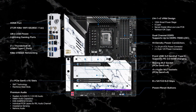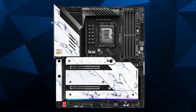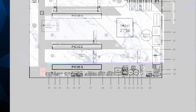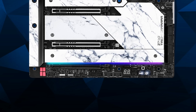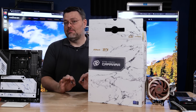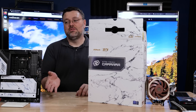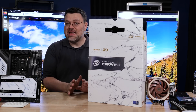This motherboard comes packed with M.2 slots — two at the bottom, two at mid-board, and one blazing PCI Express 5.0 M.2, as ASRock calls it. You've got two PCI Express 5.0 x16 slots — that's x8/x8 electrical, or x16/x0 depending on use — and the bottom slot is PCI Express 4.0 through the chipset. ASRock added a redriver to support PCIe 4. The chipset interface is an eight-lane PCIe 4.0, so there's no real bottleneck, even with a fully populated system.